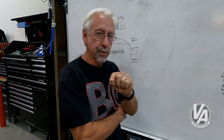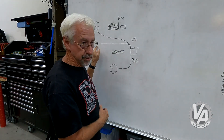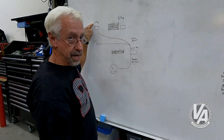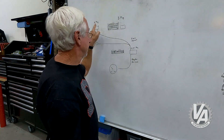First off, let me tell you what's going on with your ECU currently. Right now, you have the countershaft speed sensor or vehicle speed sensor hooked up to a wire on the engine harness side that also connects to the A-plug. That's how the ECU gets a signal knowing how fast the car is going, by having either the VSS or CSS connected up to that.